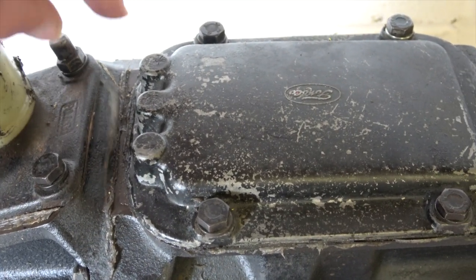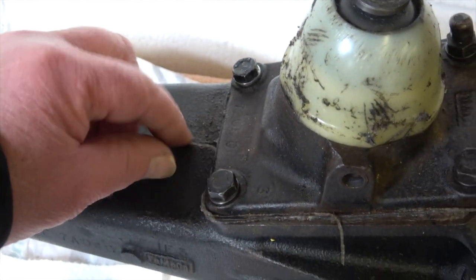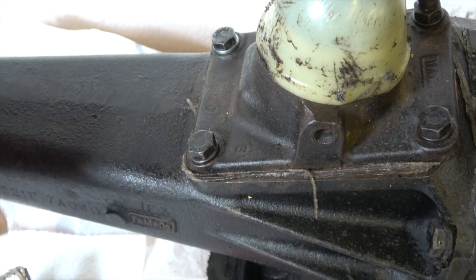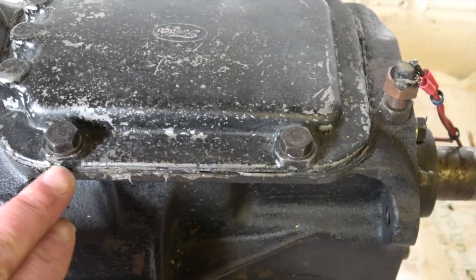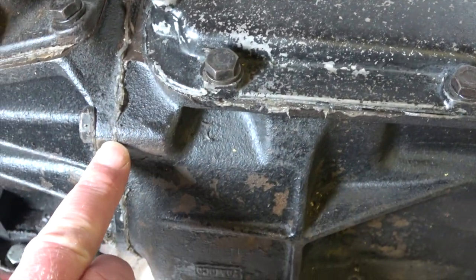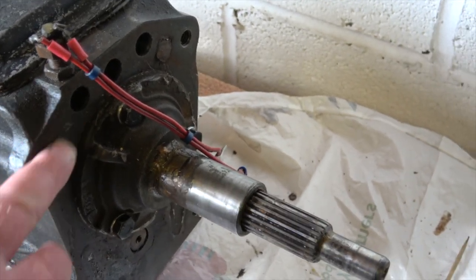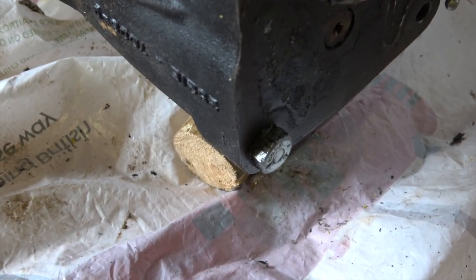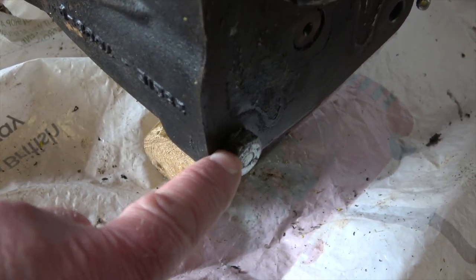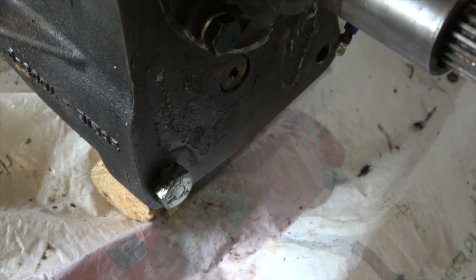You can see remnants of silicone sealant here and also here, and it's everywhere. You can see it plastered around here and on this sealing joint down here, and also when I took the gearbox bell housing off it was covered in it. This bolt here actually goes into the gearbox and you need to make sure that it's properly sealed, otherwise it'll leak like anything.